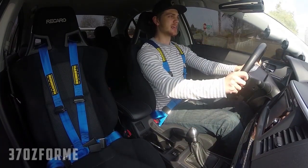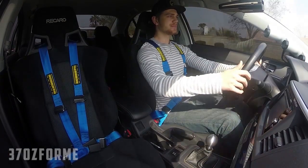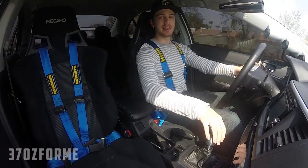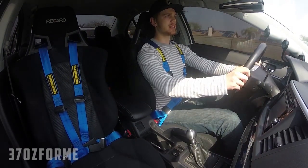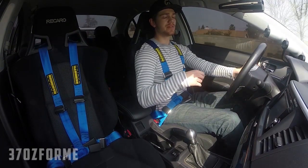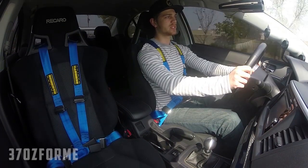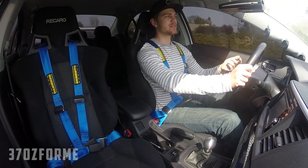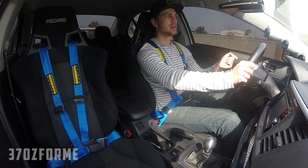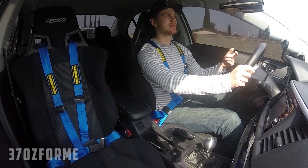Maintenance. Maintenance is key on any car, especially a car with big power. You want to do your oil changes every 2,500 to 3,000 miles. That's being more on the anal side, but hey, it's cheap insurance for me, even if you use good oil. I like to use VR1 Racing Synthetic in this car, which I put in once I did the big turbo. For drivetrain fluids, I use the Redline cocktail for the transmission, and I think it's the Dia Queen for the diff and the T-case.